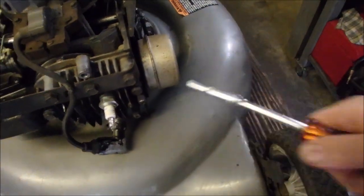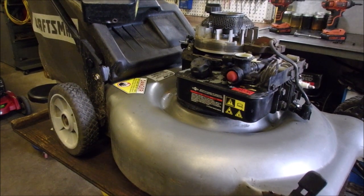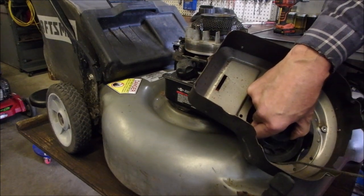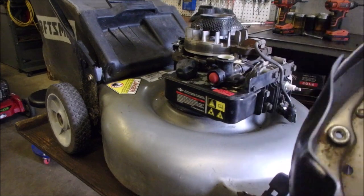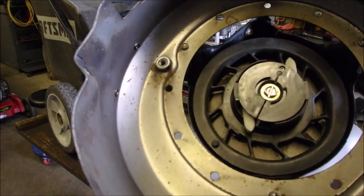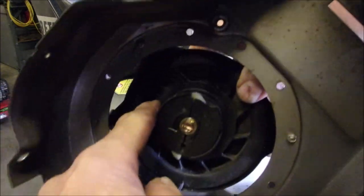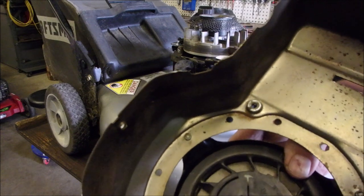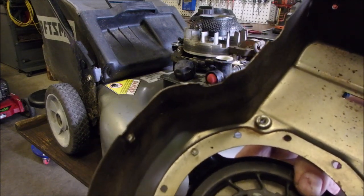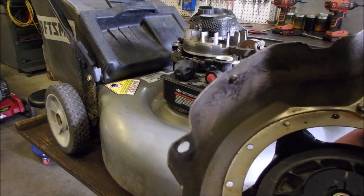We've got a loose dingy muffler on there too. So now I've got to find out how long that rope is because that's a pain in the neck pulling it through that knot. I'm just taking out the old rope right now. I'm going to put five or six winds in there and then test it out to see how it looks when we attach our new rope. We have six winds. There's our hole right there on the spool and there's our hole in the shroud, but that end seems to be a little bit hard. Try the other end — when you melt them with a candle or lighter they change shape a little bit.